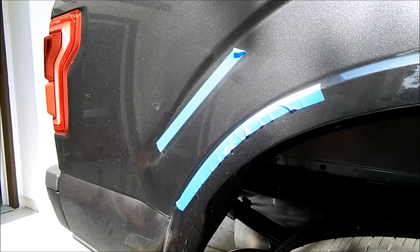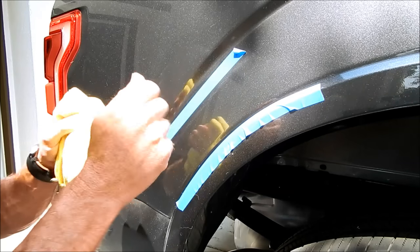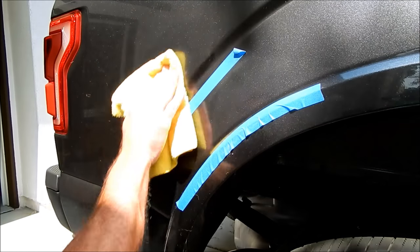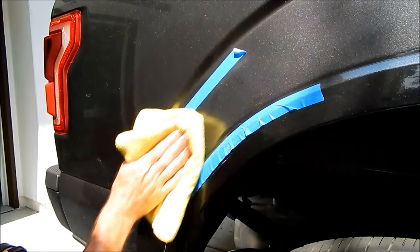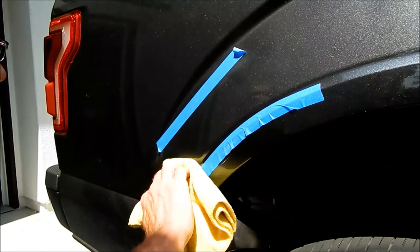When using the rotary you'll sometimes get that hop because it spins on a single axis point — that's part of what makes the rotary more difficult to learn and use compared to a DA. It is just bottom line more difficult in that respect.